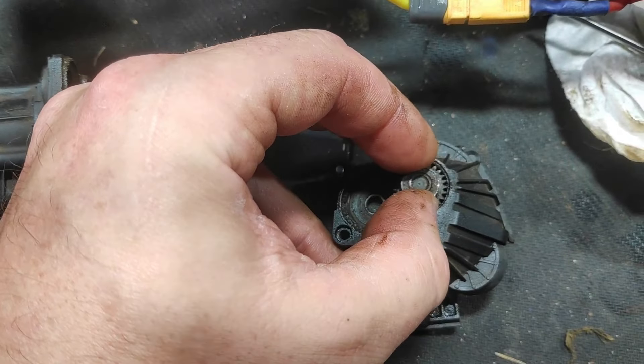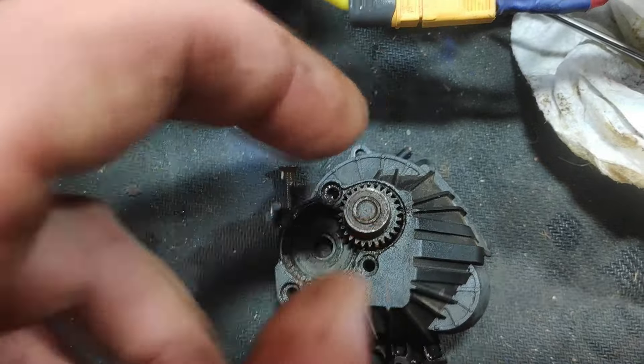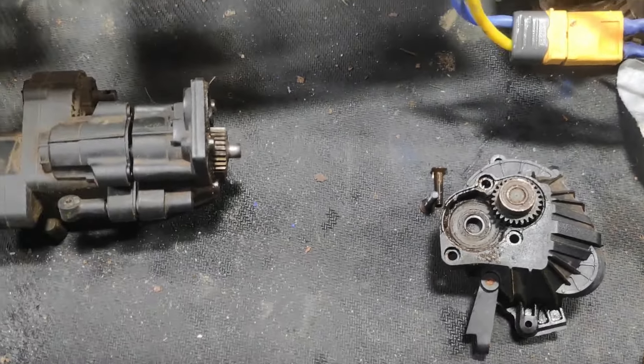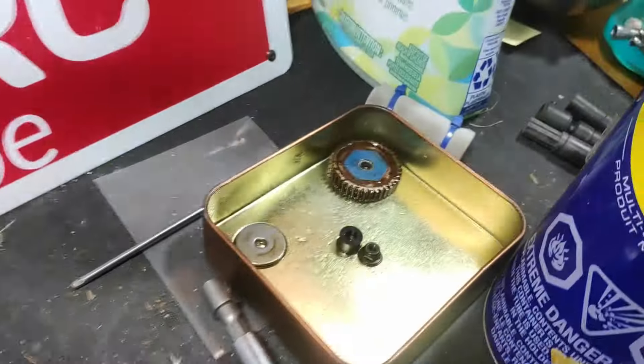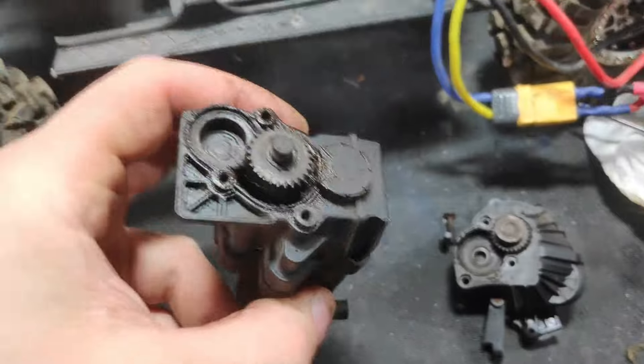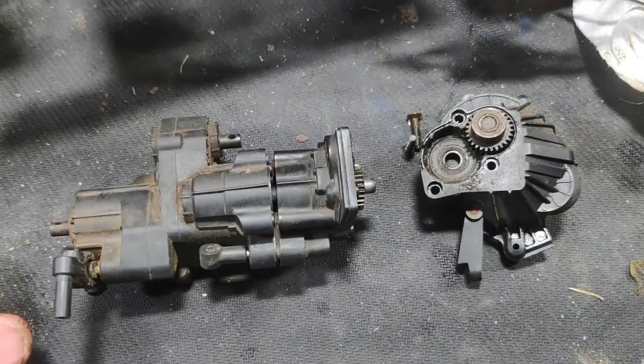We drive this in water, but there should be some remnants of grease. We're going to go ahead and replace the bearings that are in here, do a good once-over, and clean it out. I've already got the spur gear out and we got the transmission. So we're going to do a rebuild on the transmission and pull everything apart.